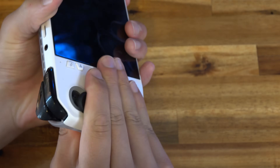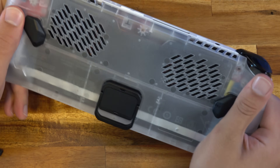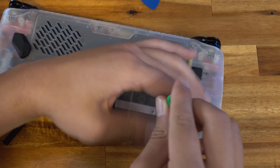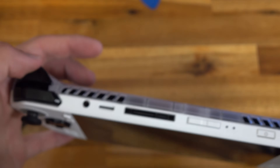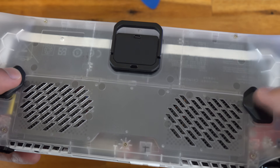Go ahead and snap your case back into place, just working around the edges — don't force anything. If you need to go back and trim a little more to make sure the battery is not bulging, go ahead and do that. I did a good enough job here for this to go on pretty smoothly. Tighten down those six screws on the back. Once it's fully assembled, give your triggers and paddle buttons a quick test to make sure they're working, and that should be good to go.